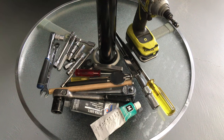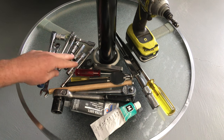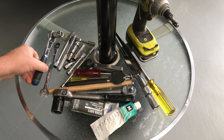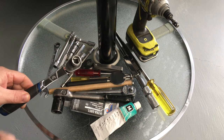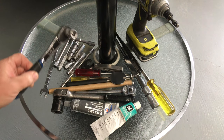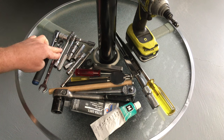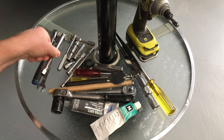So this is the tools you need for putting injectors back in. I've tried to leave all the tools I used on this table so I can say, well, this is what we use. It is mainly a 3/8 drive set. Here I've got a 14mm socket for the windscreen wiper arms, and the rest is mainly 12mm, some extensions. These are the King Chrome wobbly extensions.